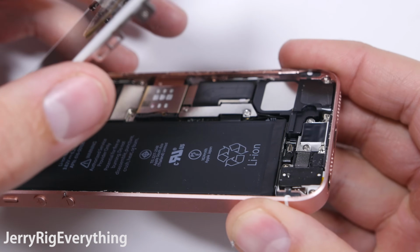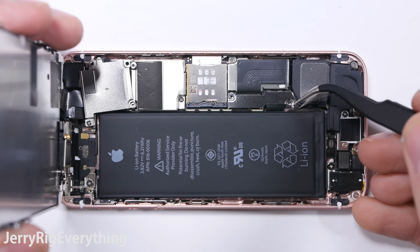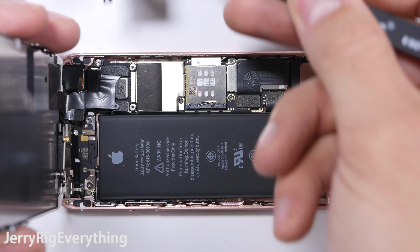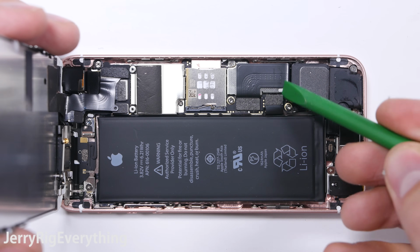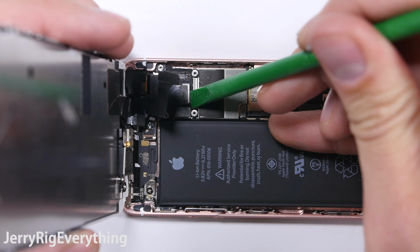Then there are 6 screws you have to remove. These are normal Phillips head screws. Remove the 2 plates and then unclip the battery from the main board. This will stop all the power from running through the board and make the repair safer. There are 3 ribbon cables attached to the screen. Lift those off, just unsnap them like little Legos.